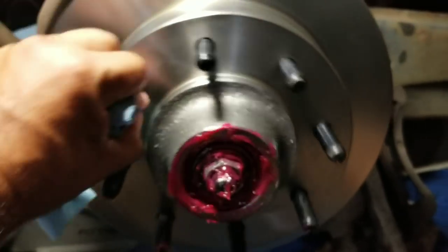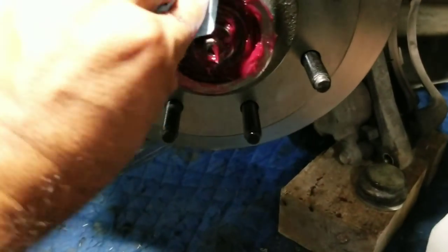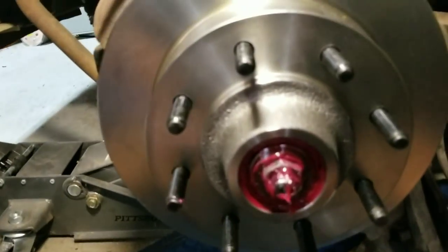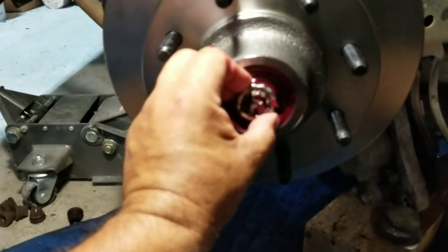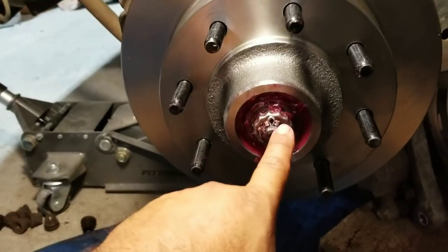Remember how easy it was to undo that with my hand — this is not an over-tightening kind of thing. When you get the grease in there, you might want to do a quarter to half a turn and then back out. Any more and you can actually damage your bearings or your spindle. When you turn this, you want it to be able to spin. If it stops right away, you have tightened it too much or your bearings are bad. Put the keeper in a spot where the hole's on top right between them, then drop your cotter pin in there. I split it going one way and the other — some people just bend them up over the top. I prefer going this way because that way it can't turn and pull out.